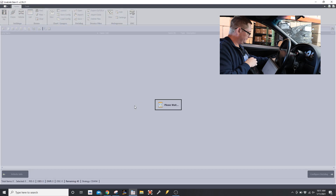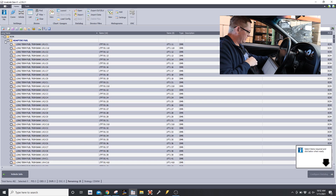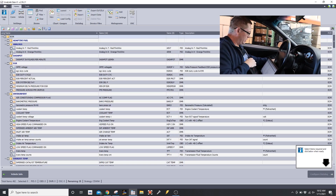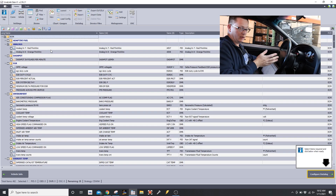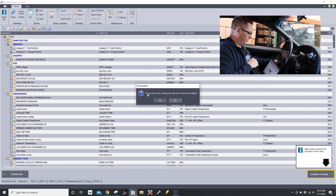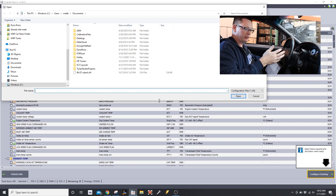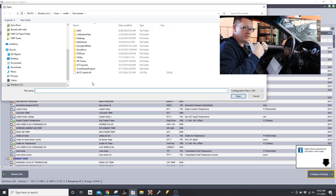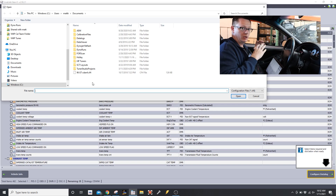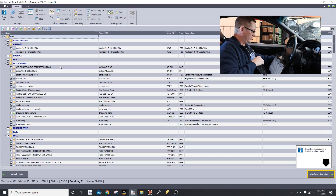Next click 'Select Items.' A list will pop up — if a long list appears just minimize it. Put a check mark on the orange firewire analog input — that's the orange wire we wired up earlier. Then hit 'Load Config.' It will ask if you want to merge these items — click yes. That merges the analog input check mark with the config file your tuner sent you. Earlier in the email chain you would have received a file ending in .cf4; have that saved somewhere on your computer. Select that config file and it will pop up. Then go to 'Configure Data Log.'